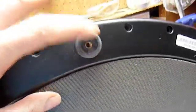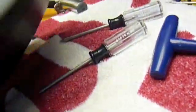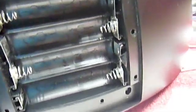You need to open it up — you start on the bottom and take out all of the perimeter screws. It turns out you don't have to take out the feet screws; you can leave those in place. Then in the back, you want to take off the battery cover, and there are 6 Torx screws in there.